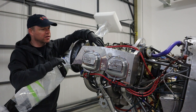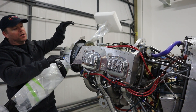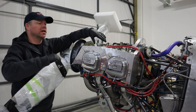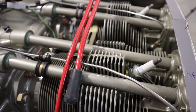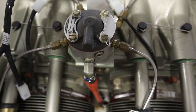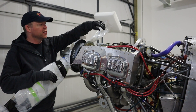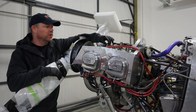Let's talk about the parts of the engine to make it all clear. We've got four cylinders horizontally opposed, spark plugs in the top and bottom, and a fuel injection spider on top with the fuel injector line going to each cylinder. Now let's talk about some of the ports on the back — I'll take the camera around the engine as we go.